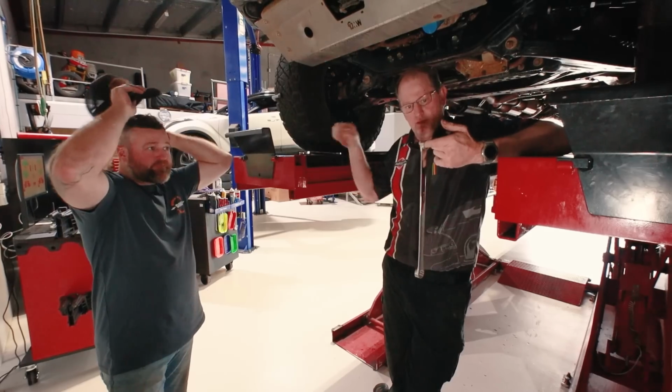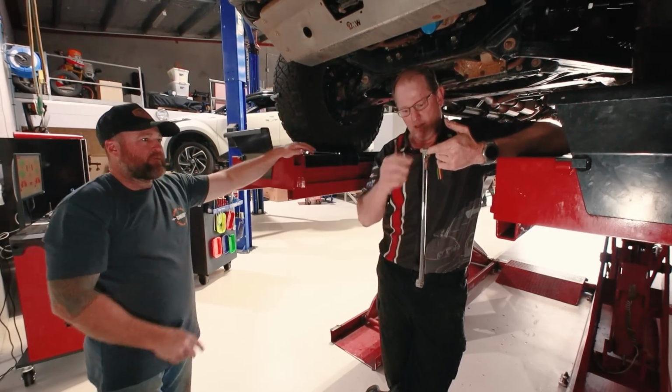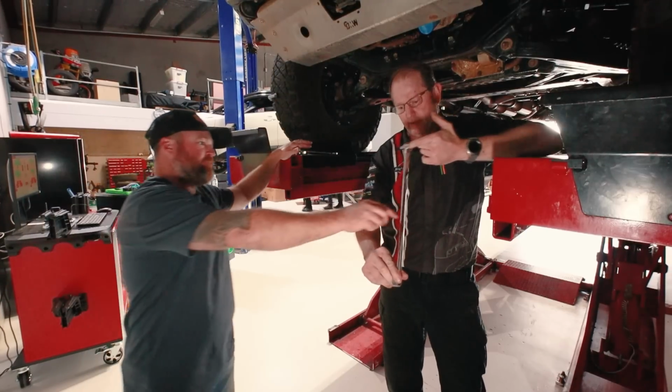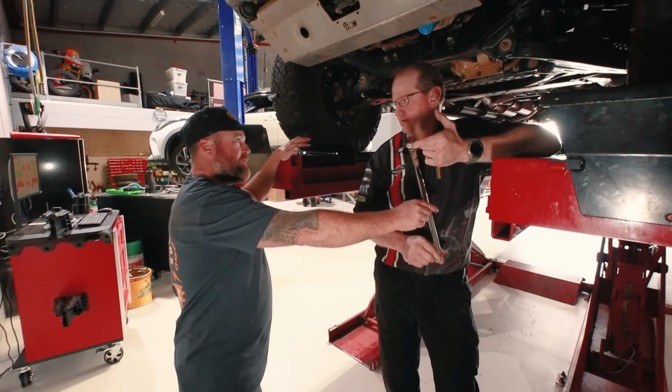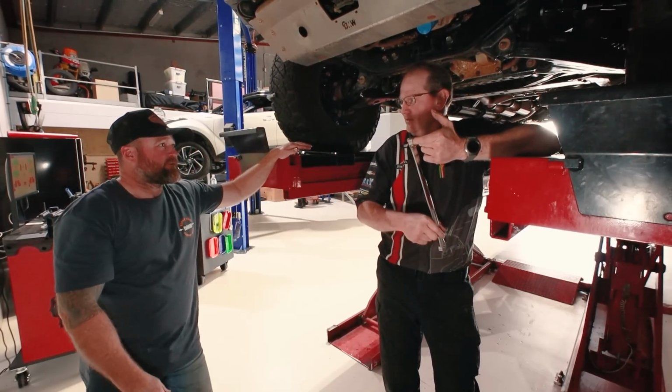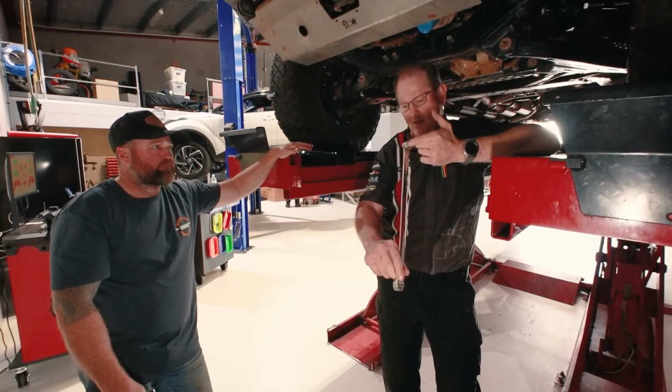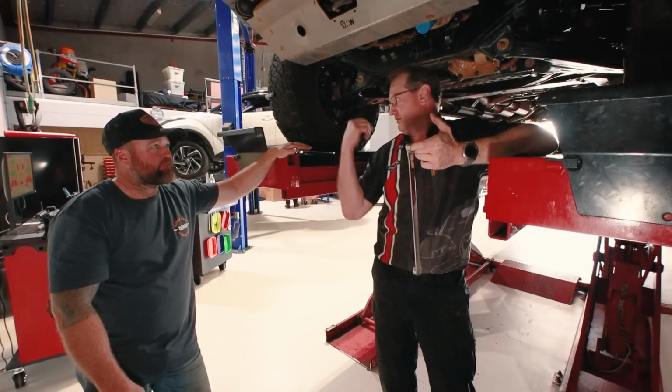Yeah, so if that's the top of the kingpin, caster's when the wheel's like that. So we want our wheel like that. Back the other way though, that's negative. Very, very twitchy and horrible, gives you your shopping trolley wobble. Yeah. So basically this wheel's going to be sitting forward like that and in a bit at the top. Yep. Okay, and same on the other side.